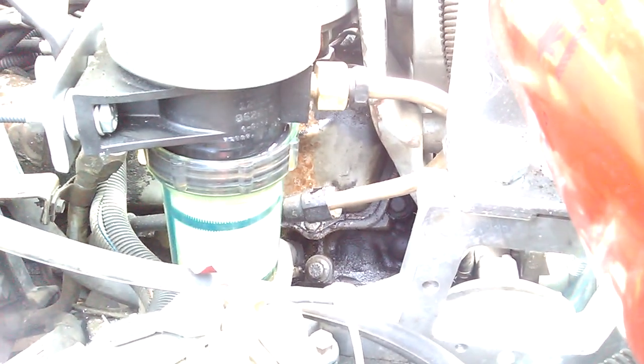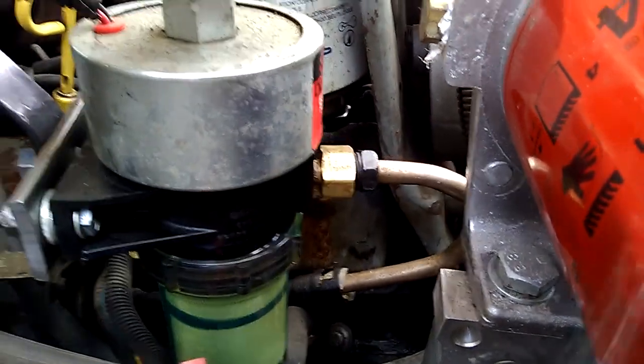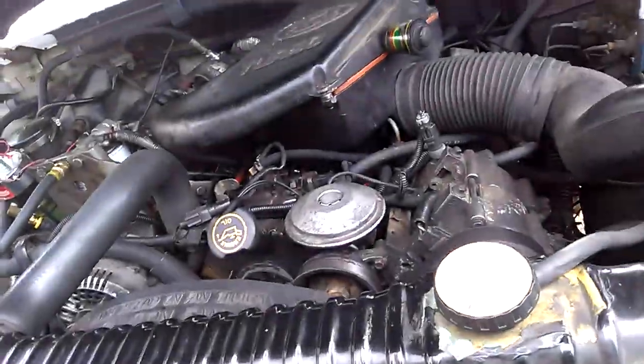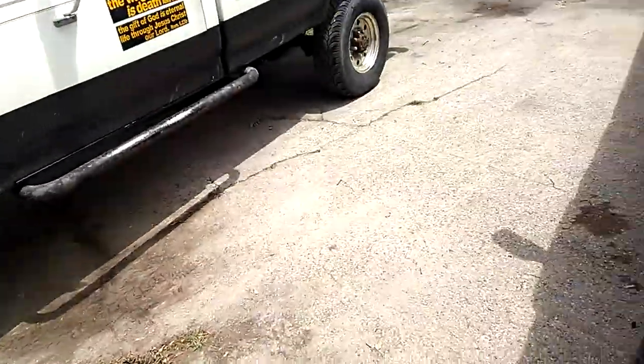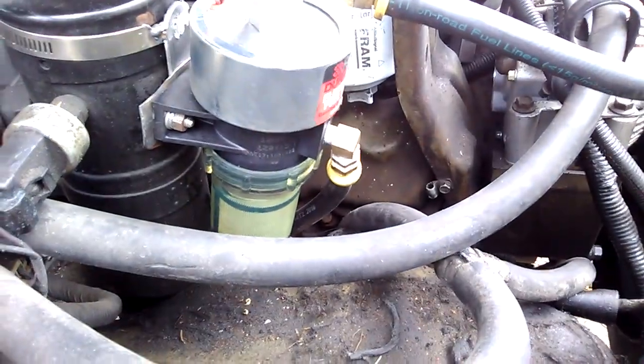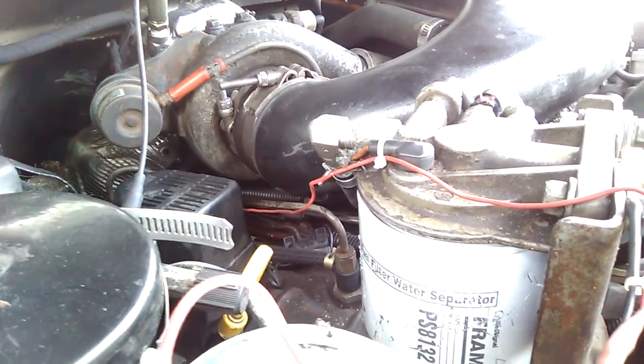I used quick connectors — I grabbed some standard brake line from the parts store and used double flare fittings. I also installed another pump on my wife's truck, and in fact I used push-lock fittings on hers, so I'll show you real quick. On my bull-nose truck I bought the Facet 40285 pump and noticed it doesn't keep up quite as well with the motor — it's only 4 to 7 PSI. But on my wife's truck it's the 40222 pump, which is 9 to 11 PSI, and it keeps up a lot better. I ran the lead to the key-on lead on the glow plug controller there as well.